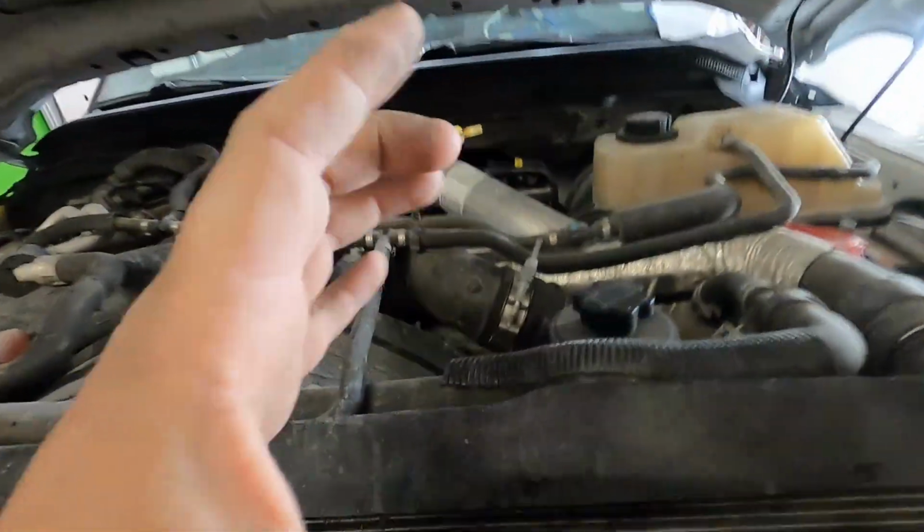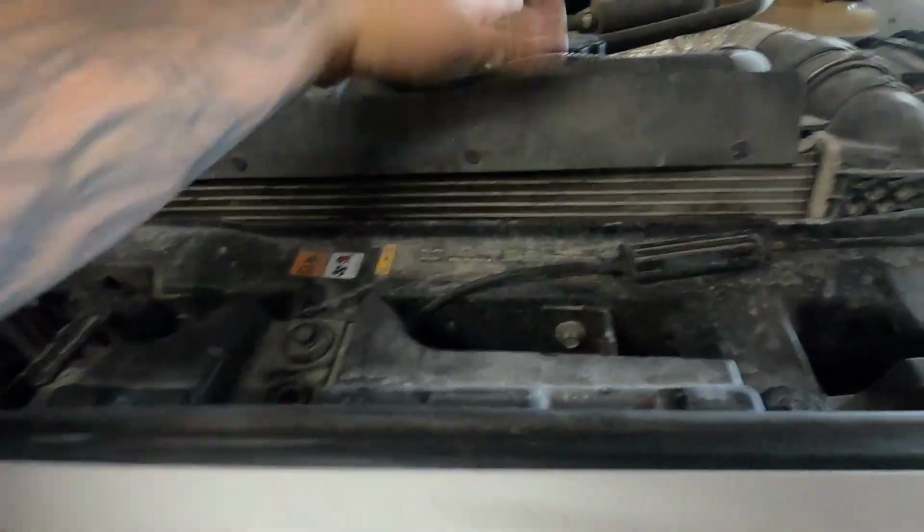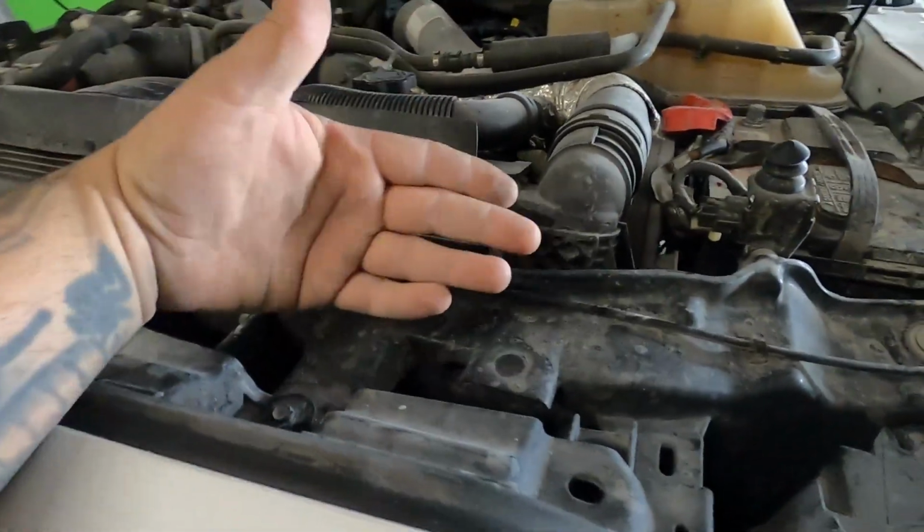While the hood's open, guys, let me go ahead and break it down to you on this one. This is the same thing as a door. We're going to tape here, and we're going to overlap the paper here. We don't want no paint getting inside. It's pretty self-explanatory. Where you don't want the paint, that's what you mask off.